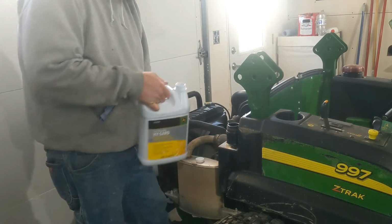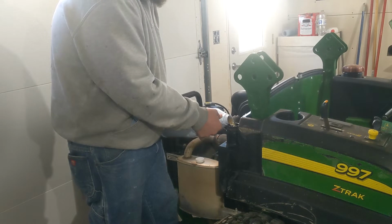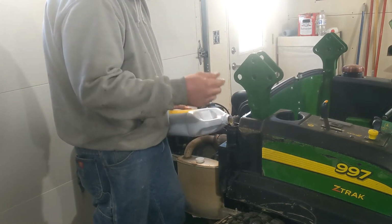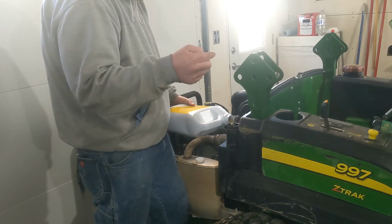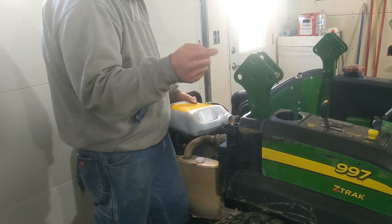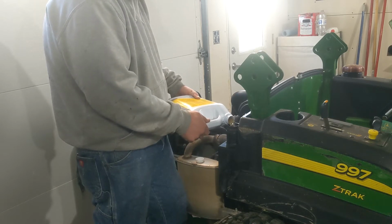The wire to the alternator, the crimping came loose on it. That was during the spring, getting it out. I started it. You can hear it sitting there zapping. I'm like, what the heck is that? And the alternator wire just sitting there going back and forth out of its terminal, zapping and burning the terminal. Glad I found that before it burned down the lawnmower someday.